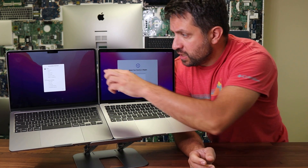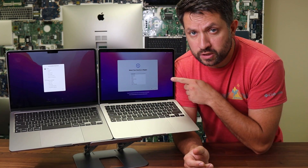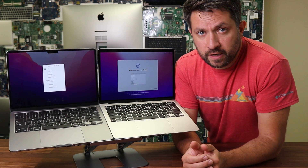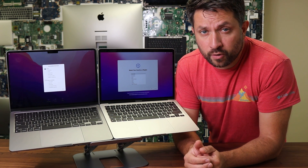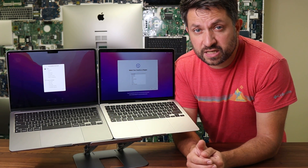As you can see, the 2022 version is about a quarter inch on both directions wider than the 2020 version, and the resolution has also changed. The 2020 version was using 2560 by 1600 with 400 nits, where the 2022 version uses 2560 by 1664 with 500 nits.